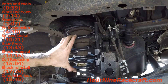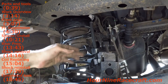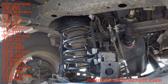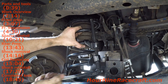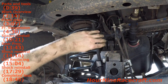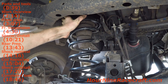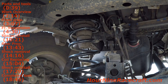So what I've done is gotten my spring clamps and clamped down the spring just a little bit to give me a little room. You can see I got it in there - I just have to put my ratchet on it and loosen it back out. I've got these facing down so I wouldn't have been able to get my ratchet on the way it was before. These were also pushing on the axle. I'm just going to loosen this back. I'll just have to clamp the spring on the other side and then loosen it up. The spacer is in and in place. This is a spacer - it's not for off-roading - but this one is in and I'm going to work on the other side.